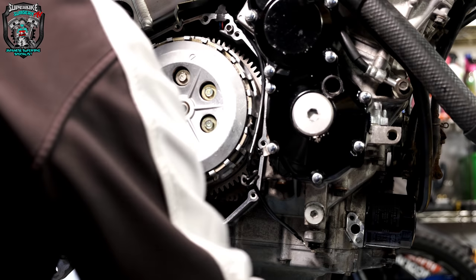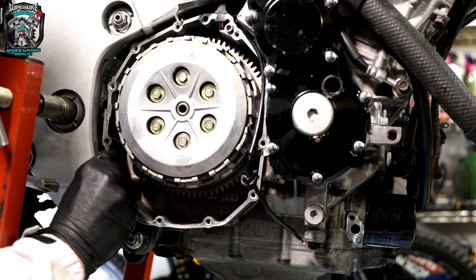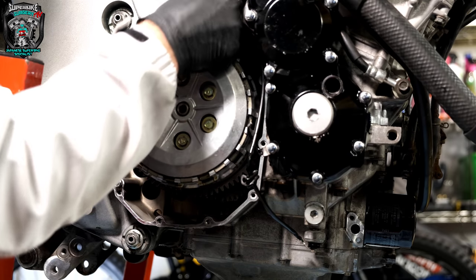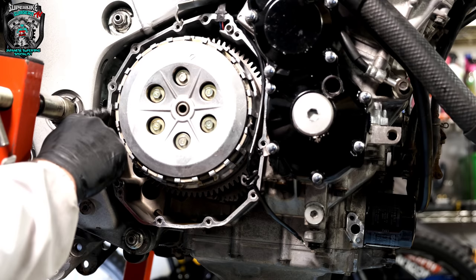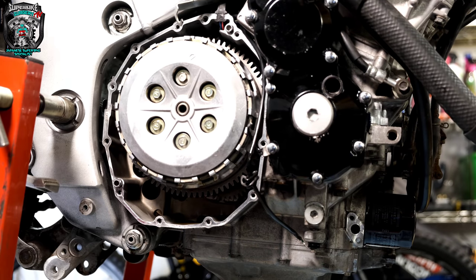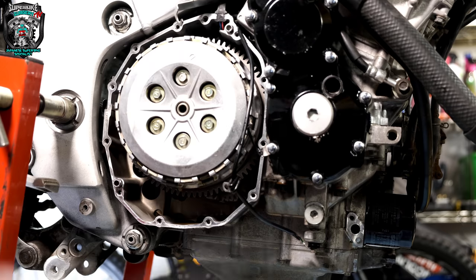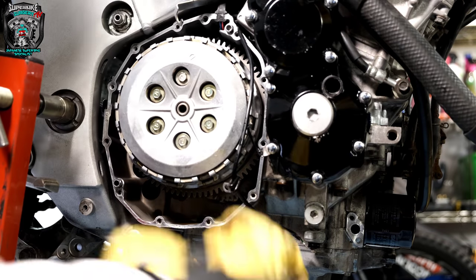That's together. Clutch basket done. Clutch cover: I've got a new clutch cover gasket, a couple of dowels, and where this wire passes through, the rubber piece is loose so that'll need a little bit of silicone around the back of it and over the top. A couple of little bits of sealer where the crankcase halves join. New gasket on, tighten the clutch cover up, put the clips in the right place — sump's all on. Just waiting on the exhaust pipe, and I've got a couple of broken bolts to get out of the frame. You'll get to see it with the exhaust on and starting up, and that'll be the end of part three.